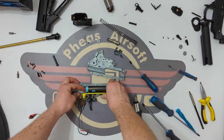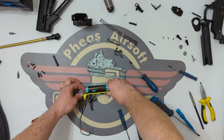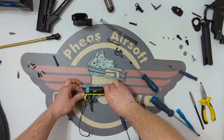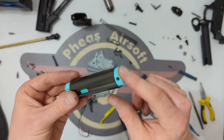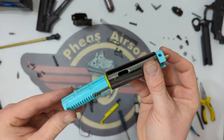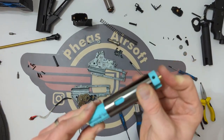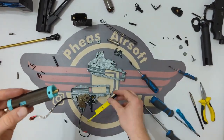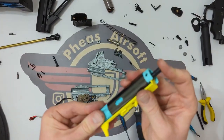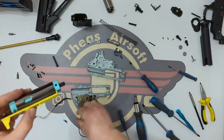Let's have a look at the compression. Let's lift the compression assembly — that's well stuck in there. So take the nozzle off first. We've got a cylinder head — I'm just going to brace my finger on the cylinder head and hopefully — there's a tiny bit of air leak but it's really good compression in there. I expect it to be slightly worse again because you're working against another sort of resistance. There is definitely pressure needed to do that, so there is compression in there — I'm happy with that.